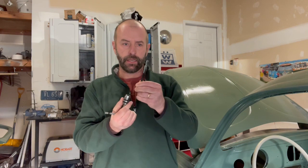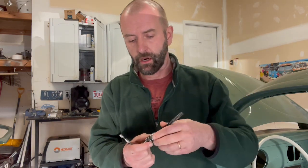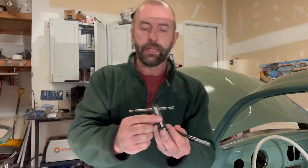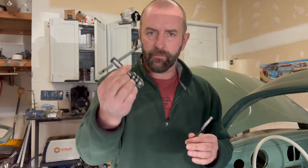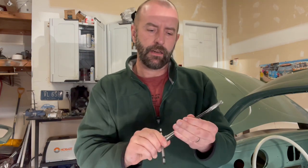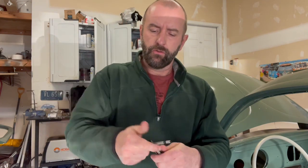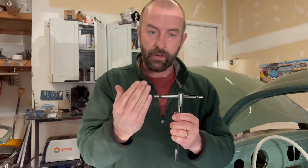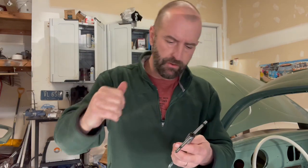Okay, so here is a reamer. I got this at Wolfsburg West. This is how it comes. These aren't cheap. Like any specialty tool, cost me $40. I'm filming this in February of 2023. And you'll want to get a T-handle. You can get these at Harbor Freight. Set of them is $10. So just get that down in there. Tighten that up real nicely. And that gives you a nice handle and correct, straight down pressure. Don't use vice grips to try to spin this because vice grip is not even and it will wobble.